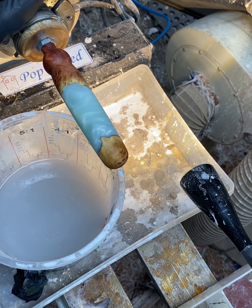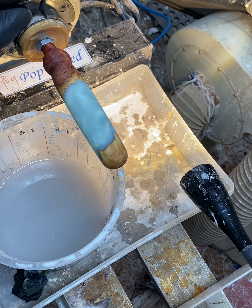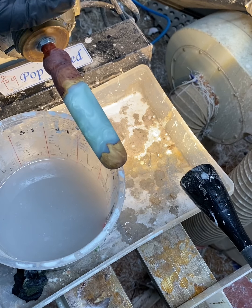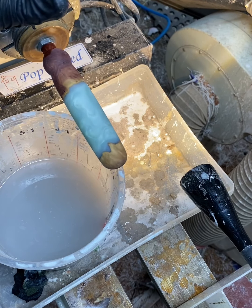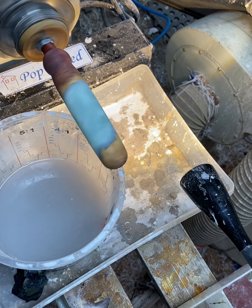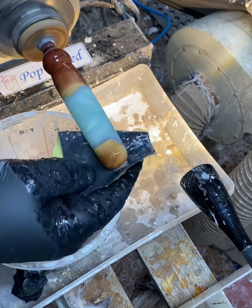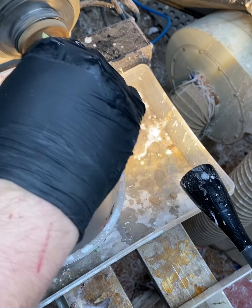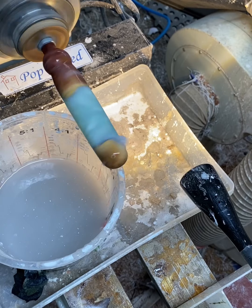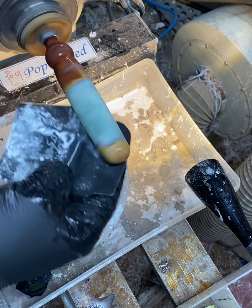And what's going to happen is you're going to see all these little shiny spots. They're your lows, and you keep sanding until they're gone. I've got a couple of really minor ones, but I'm okay with it. Overall, I'm happy with what I'm looking at. I know that the rest of those are going to sand out through the following grits. So now we're going to jump to 800 grit. Now I'll move pretty quickly from here. Jump to 1200. Sorry about that, notes. 1200.